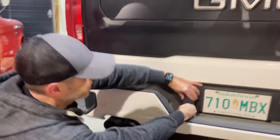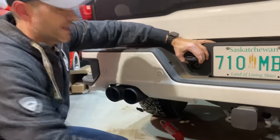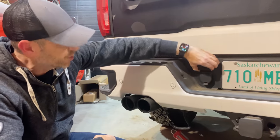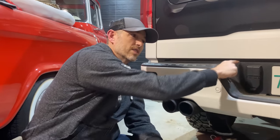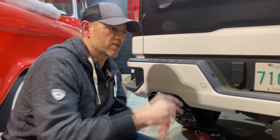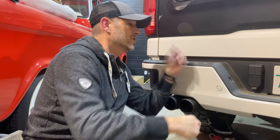Now you might be a light strip installation expert, and you're well aware that in some vehicles — I'll emphasize some — you can tap into the back of the seven-pin trailer harness. This kit comes with everything you need to do the wire taps and make the proper connections, or you might have a flat four connection. But for this truck specifically, and some others like it, they recommend a plug-and-play harness. I ran into all kinds of problems with electrical issues because the trailer sensing features just one manipulation of wire — tying into one tail light versus the other — and it sensed that that was happening.